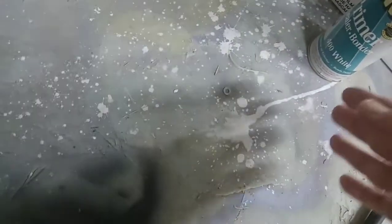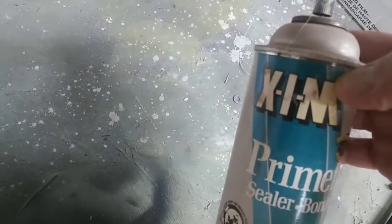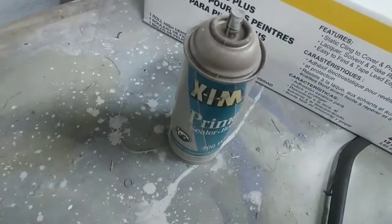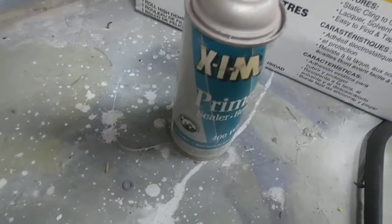Thousands of dots come out of a spray can — you spray just until the dots connect. There is no coverage; you'll see right through it. Do not put two coats on, put one coat. If you put on too much, when you go to apply the other material it'll still be sticky and the new paint will wrinkle. That's a mistake — put it on much lighter. You're not trying to make it cover at all.